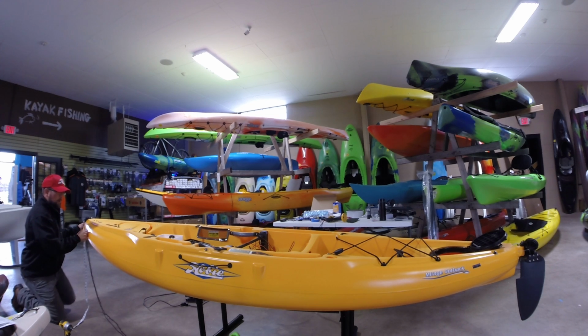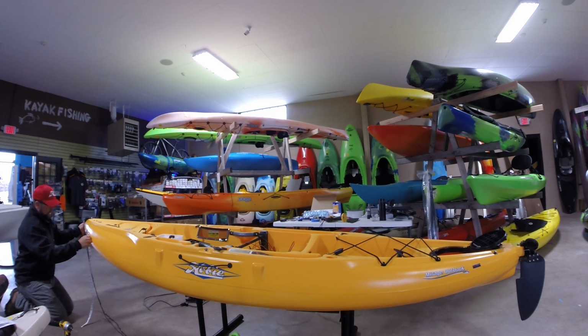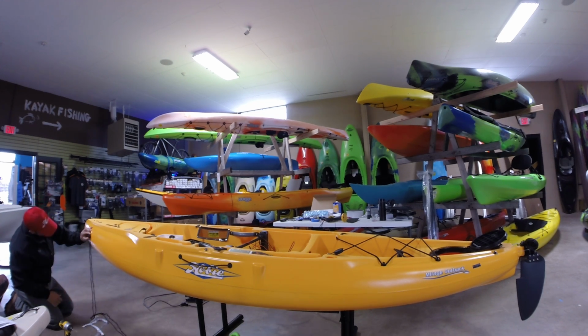Now you'll see on all these boats where the mold was put together, there's a line. You want to put that anchor pulley right above that line. So I'm going to mark my 24 inches. I'm going to kind of eyeball and center this. I'm going to put it above my water line. Go through and drill a hole right here.